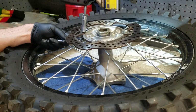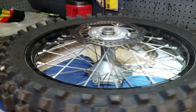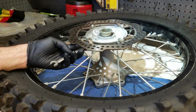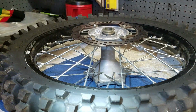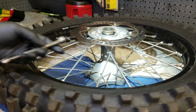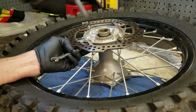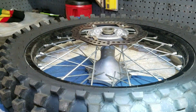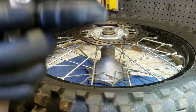It had motor oil in it, proper level of motor oil, nothing like that, so we can't say that was the problem. But my brother asked him how he rode the bike when he first got it, and that's what he said. He said he put it in fifth gear, it was just going down the road in fifth gear, and that's what happened. So you're not only breaking in the piston, crank, everything like that, you're also breaking in the transmission and all them gears that spin on shafts.